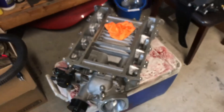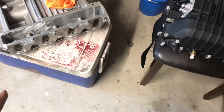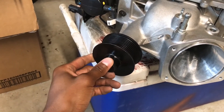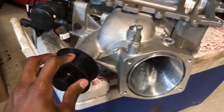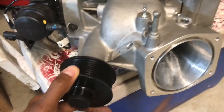I should be picking up the car in the next two weeks. I've got my lid and my injectors, and I still need to get a fuel rail. This is the stock pulley — I'm going to upgrade to probably a 2.5 inch pulley. I don't want to go too much, but I think that gives you about three to five more pounds of boost over the stock one. I also reconnected the vacuum line back to the supercharger. That's pretty much it for now.